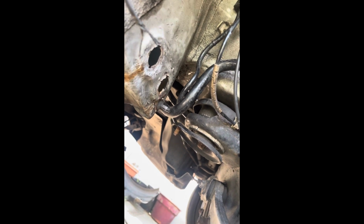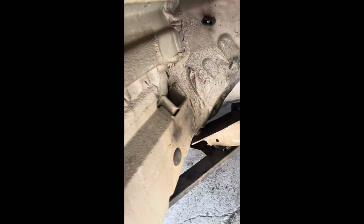With my fuel pump, 2 fuel pumps in there, but the wire comes from the trunk right there where those 2 holes are, goes over the subframe, comes down over here, then goes over the gas tank. So you got to drop it, and it goes underneath the car to that hole right there, and there's a whole bunch of 10mm bolts holding it up to the car. Comes out this hole, then goes through another hole right here up into the engine bay, comes up underneath the DME box, and look where it bolts up to the power wire.